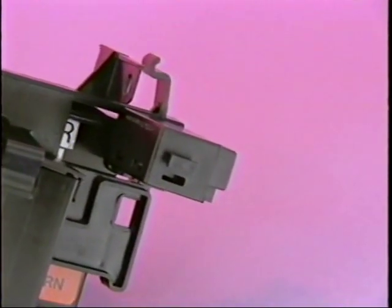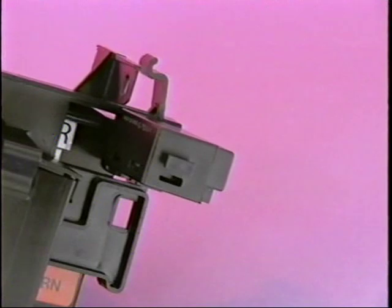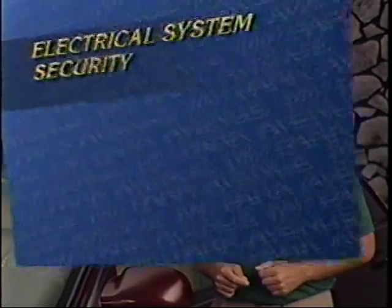The old turn signal flasher cans have been replaced by an electronic module. The turn signal switch is now only used as input to the flasher module. The flasher module controls output. In the case of lamp outage, the flash rate of other lamps will double.